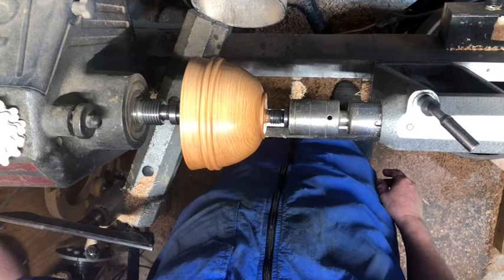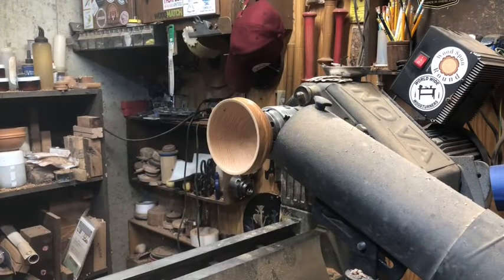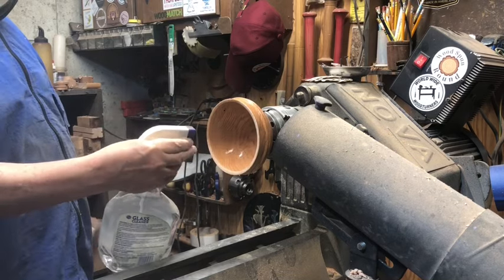I would suggest using just a little bit more wax on your paper towel to soften that up a little bit, but buff it up softly at first just to take off the excess, and then you apply more and more pressure, building just a little bit of heat, and that helps that carnauba to set.